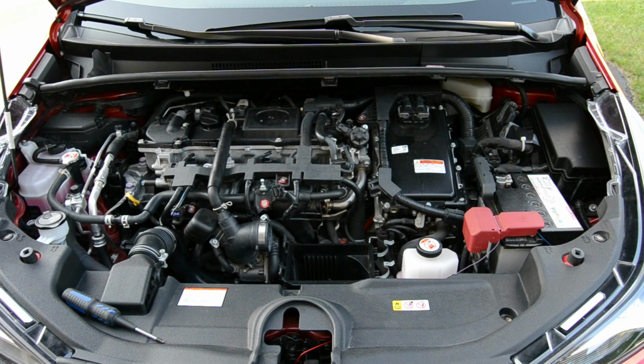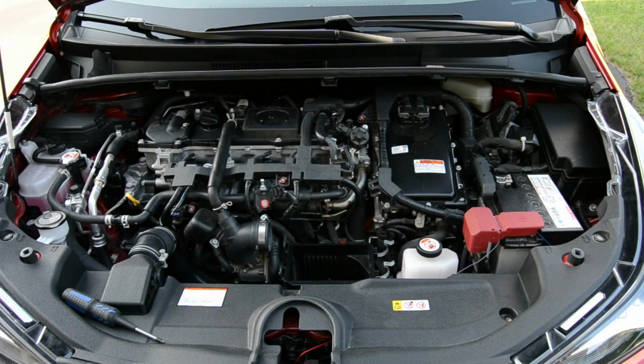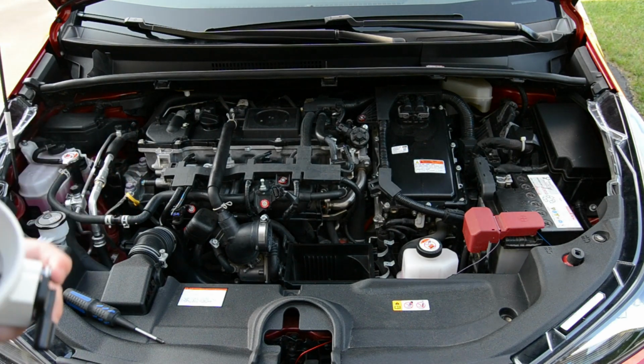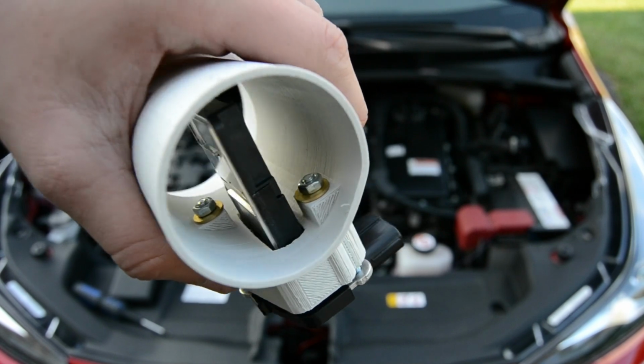So it is by no means an absolutely perfect seal, but it should not be bad enough that you will have any kind of vacuum leak. Next, I reach in there with the nut, which I'm not doing on camera because it is very hard to coordinate, and then I just tighten it down by hand, and after this, I will be tightening it with the screwdriver. Now I've got both of them in, that's what it looks like on the inside, and now it's time to tighten them.